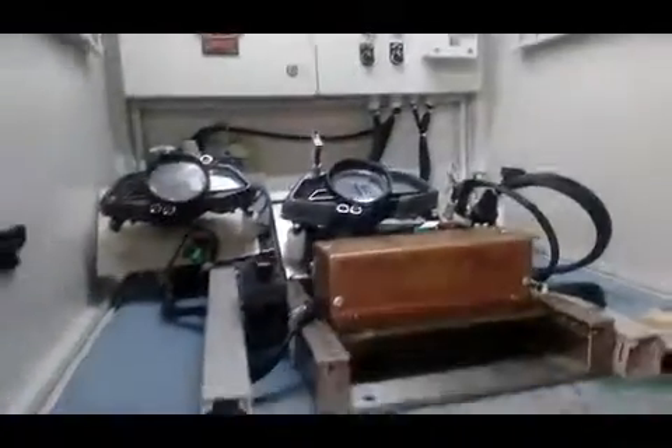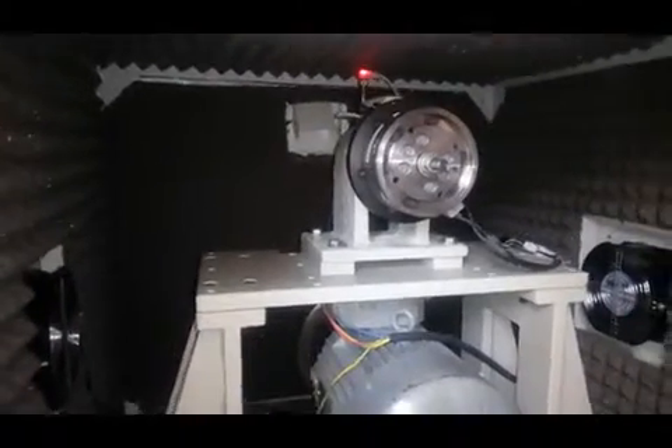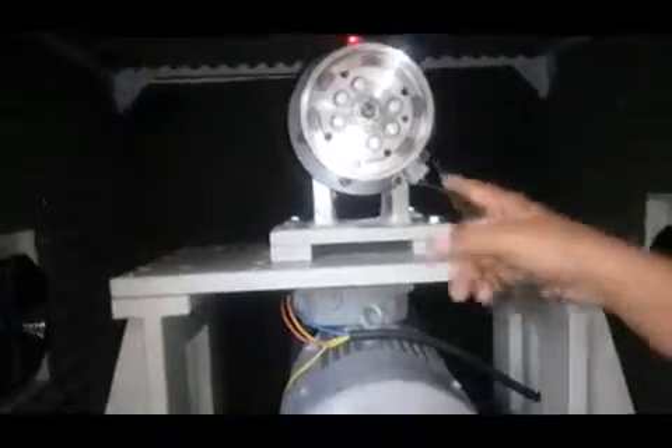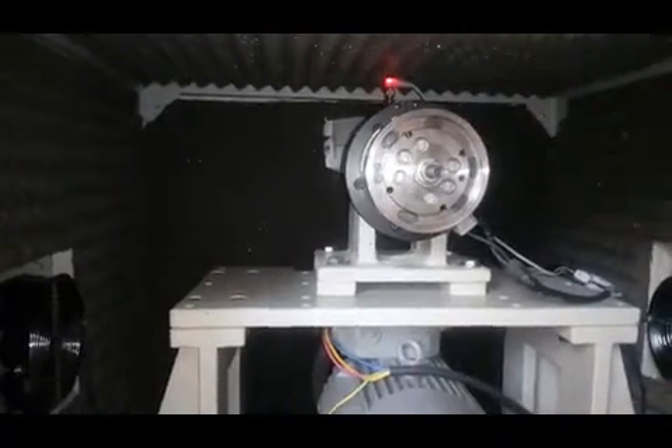In our vehicle, there are different RPMs, and we get 2 RPM signals in this cluster. We designed a system which is enclosed in this chamber. This chamber is a noise-proof chamber in which a motor rotates the magneto, which gives pulses to our cluster and measures RPM via this sensor. We designed it in such a way that it is easy to change and maintain.